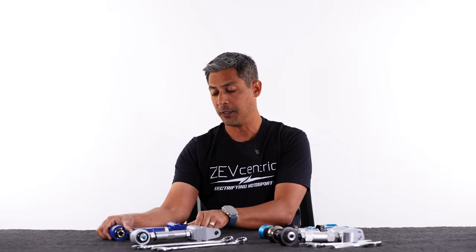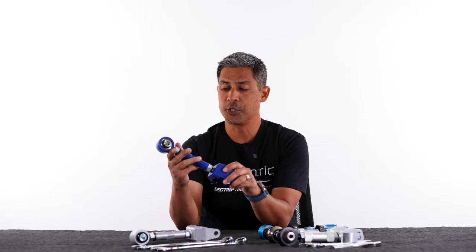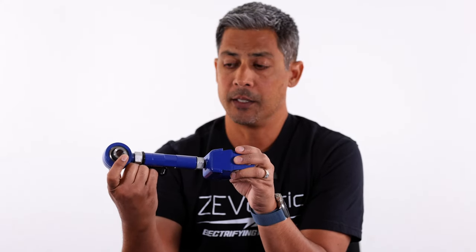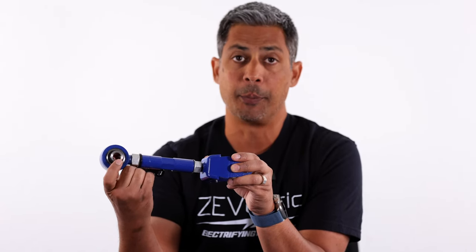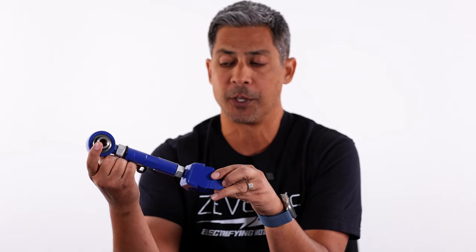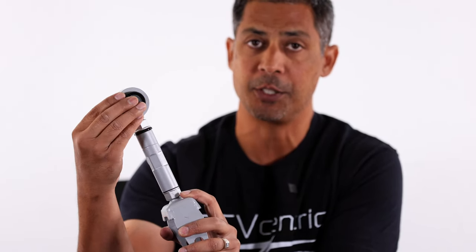Starting off with the Megan Racing arm: initially Megan Racing had a polyurethane bushing in here and they recently revised this to a bearing. I think there was just a lot of deflection in that bushing and at some point they decided to upgrade it. This arm is around $170 — under $200. This arm here by Whiteline looks very similar but a different color, and it does have a polyurethane bushing. The Megan arm bushing just kind of sandwiched in — it wasn't actually pressed in — and I think that was a big part of why it had so much deflection.